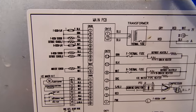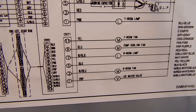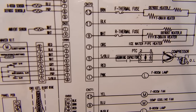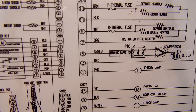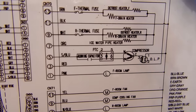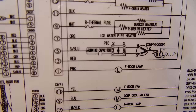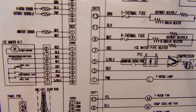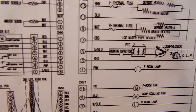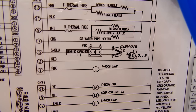Here's a look at the wiring diagram on the back of the refrigerator. The circuit we're going to be looking at is number five, right there in the center of the screen, with the S-slash-blue — that's the sky blue wire. It looks like it runs through the running capacitor, then over to the compressor through the overload protection. We're going to see if power is coming off the control board and making it to the compressor — so we either have a bad relay on the control board or a bad start device on the side of the compressor.